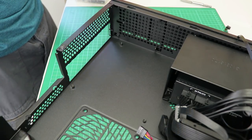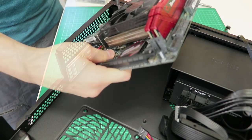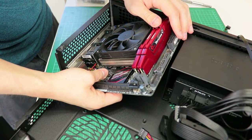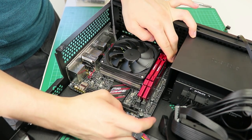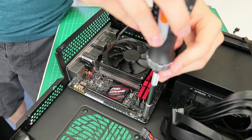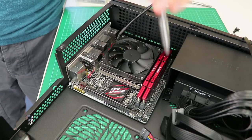As for the motherboard, the IO shield is the IO shield, not much to say there, but the motherboard was a squeeze to fit in, so if you're struggling, you may want to install the power supply unit afterwards, and it may be helpful to someone to know that the standoffs are fixed, so if you destroy a thread when installing the screws, it's probably shot, but to avoid that, I'd recommend counter-screwing before screwing, as painful as that sounds.